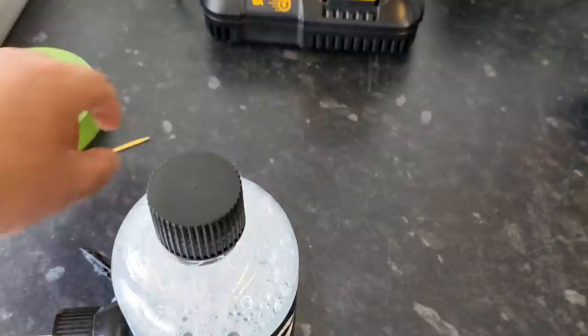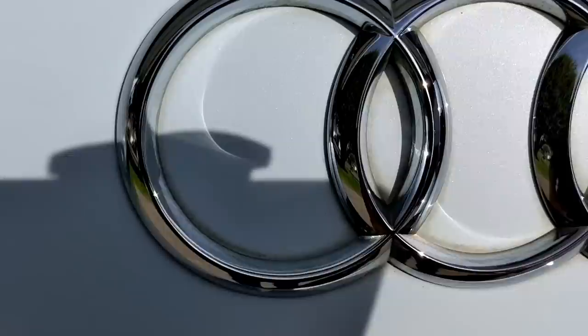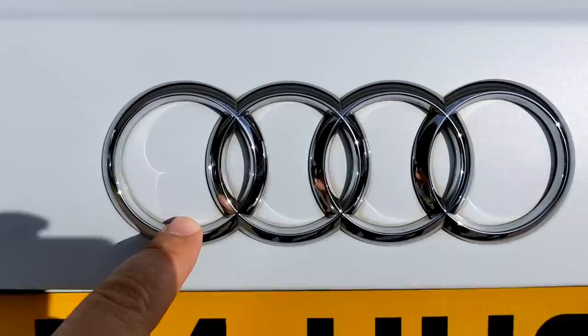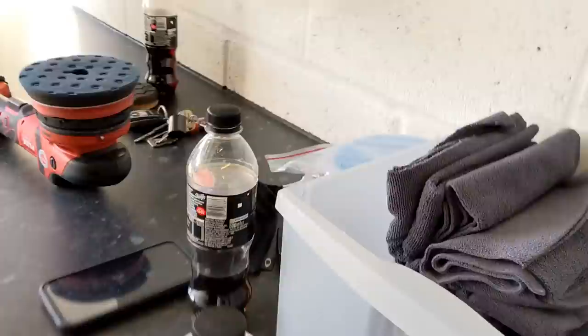We basically have to accept that where we are is good enough. What this video is about is Purge Water Spot, a new product from AutoGlanz, kindly sent to me from James from County Detail. Now look at this in here — you might think that's stuck-on dirt, and it looks like stuck-on dirt. The polish isn't going to remove it; you're going to make a mess and get polish under the badge. I think this is where water sits in there. We've tried poking at it and it won't come off. I think water spot remover, which typically has a little bit of acid in there as well as detergent, is going to break down that mineral deposit — it's like scale on a tap. That's my theory, because everything else hasn't worked.